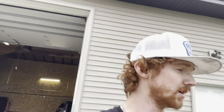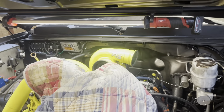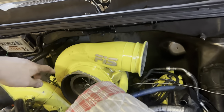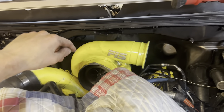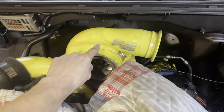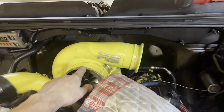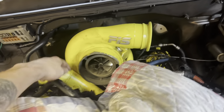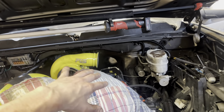Update: it is Saturday May the 6th. One of the trucks — an LML that was in for exhaust tune and some other work — got picked up today, got paid for that. The owner dropped his brother's 2020 L5P off, which is getting the same treatment plus an intake and other goodies. On the race truck, we got the turbo about halfway in. We got the oil drain done, which is the hard part. Now it's just the up-pipe gaskets. The new turbo sits about an inch and a half lower, so I'm a little concerned about whether the hot side pipe will work, but the intake already checks out.